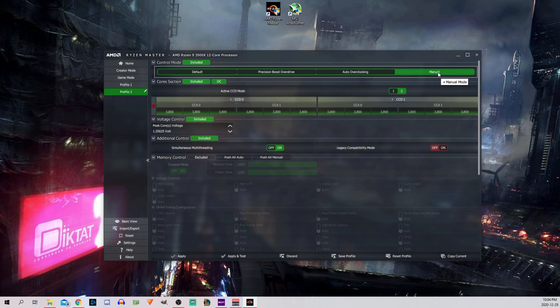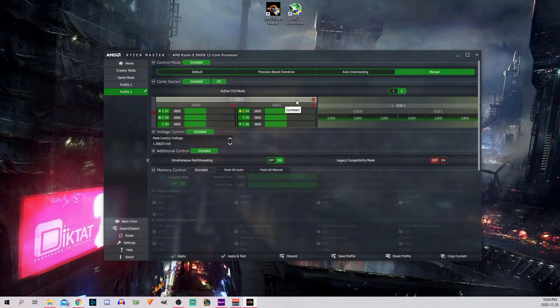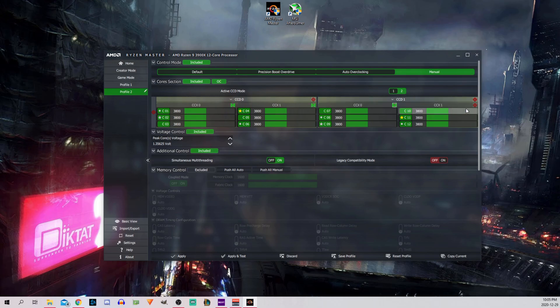A more advanced CPU overclock would be changing individual core speeds, which is not impossible, but definitely a lot more time consuming. On the contrary, you could just set one speed for all cores to run at, but the problem with that is that they will only run as fast as the weakest core. The option I chose was overclock per CCX. Essentially, each CCX holds 3 cores, so every group of 3 cores will run at different speeds. The speeds that I set them at was 4500, 4450, 4350 and 4350. This overclock makes sense for Warzone as the game is very poorly optimized and prioritizes single core performance over multi-core.